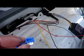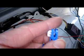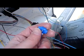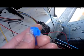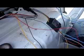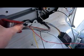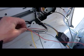One thing I haven't mentioned is the connectors. I have them wrapped and I'm going to be soldering them. If you don't have a soldering iron, you can use crimp clips — they're okay. The cable from your relay goes into the dead end, the cable you want to clamp onto goes into the straight-through end, and you squeeze it down with pliers so it closes over on itself. They're not really the best though — I'd prefer to just solder them and put a little bit of heat shrink over them.